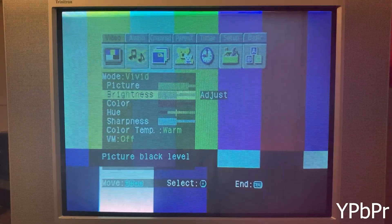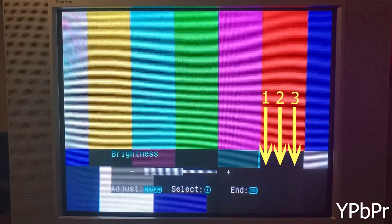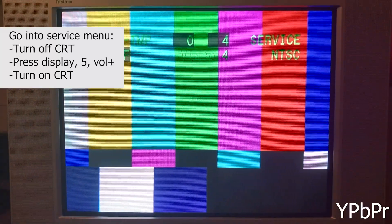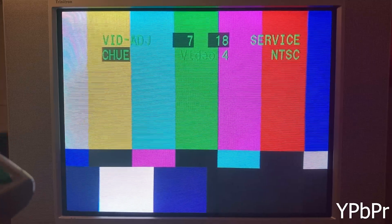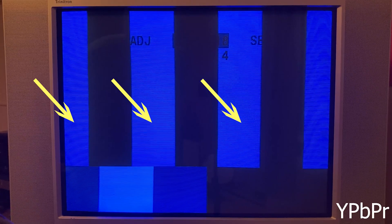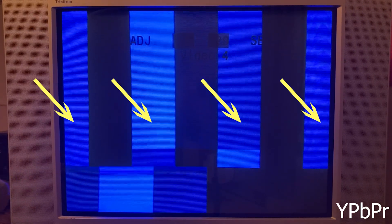Using SMPTE, we're going to adjust brightness first — you can see the black bars on screen. The third bar to the right you want to be able to see, but the two bars to its left you need to bring the brightness down until you can't distinguish between them. To adjust hue and color, go into the gun settings — R on, B on, G on — and turn off R and G guns to get into blue-only mode. Then adjust hue and color until the bars on the SMPTE pattern line up. I'm showing what it looks like when it's wrong — there's a visible difference — but when done correctly they all become equal.